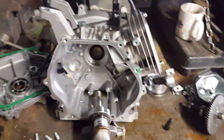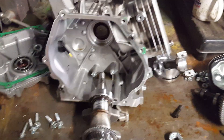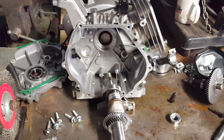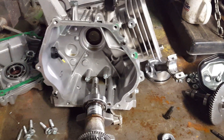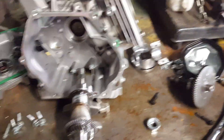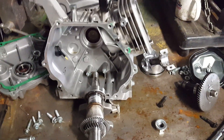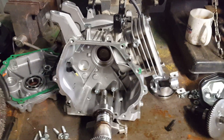When you run too much oil, it whips the oil into a froth and aerates it, so you're not getting the same degree of lubrication to your bearings as you would with the proper oil level. In a small engine like this, it's also detrimental because if it's putting out more heat, that oil doesn't have anywhere to go to be cooled. Once you've whipped it into a froth and it's red hot with more cylinder pressure, it wipes the bearing clean and causes oil starvation — even though there's more oil than you need, it causes the same result as not having enough.